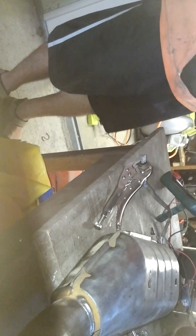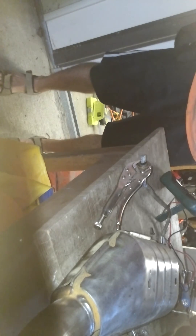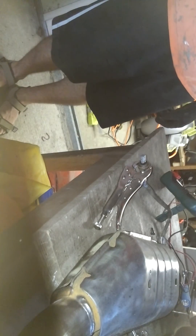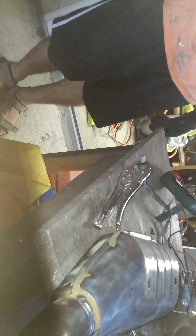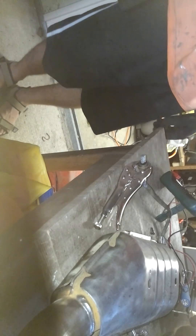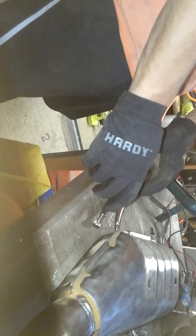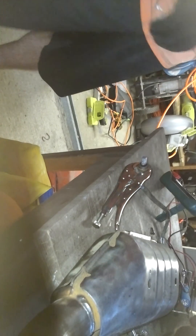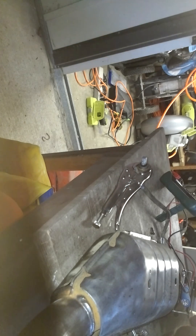I got my insulated gloves on so I don't hurt myself. And then it also drops down to .006, so that one is good. It heated up and dropped fairly quickly. Now I got two good O2 sensors. I'm going to do that with my other two as well. That's how you can test your O2 sensor once you've taken it off your catalytic converter.